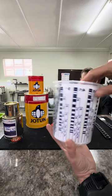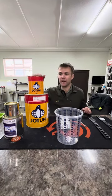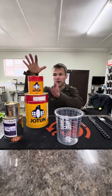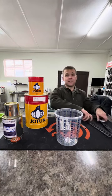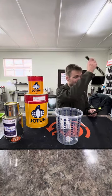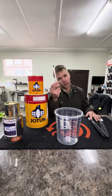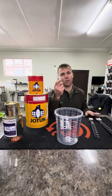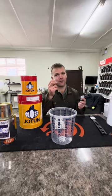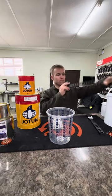Hot Top Flexi — two parts, four to one ratio. It's important to use two separate mixing sticks. If you stick this in your paint and then into your hardener, you're going to throw the product away. Just a quick tip. Another thing: you cannot row up river with a round stick — use a paddle. It is very important, otherwise the solids are not going to be mixed in properly.